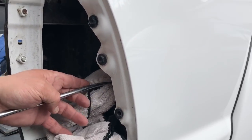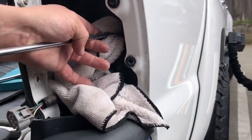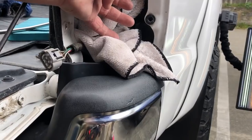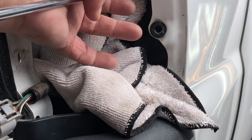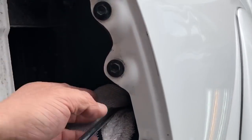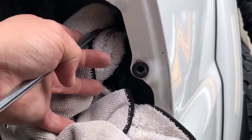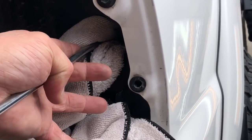I'm right about here — I'm using my number one tool, sharp tip, just a normal blunt tip because it has a 90-degree bend in it, which allows me to get the fulcrum that I need. If I need to get in there super tight at the end with a different tool, I can always zip a hole in this piece of metal right here, which is never seen once you put the tail light back on.